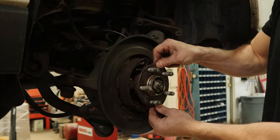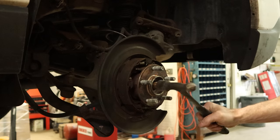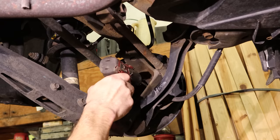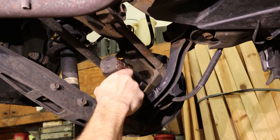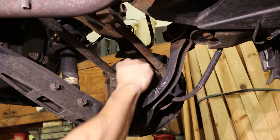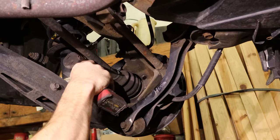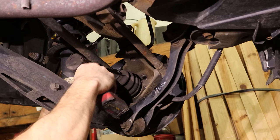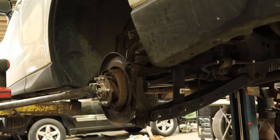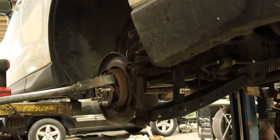Then we can pull our rotor off of here. Our bearing is pretty loose. Pull the drive axle nut off of it. Tap the drive axle out — I was honestly expecting much more of a struggle. So now we can unbolt the back of our hub — just four bolts on it to hold it into the knuckle. We're going to put one bolt back in a couple of threads just so we can knock this out of here. Big Bertha is going to help us. The drive axle came out easy, but the hub is not coming out of the knuckle.